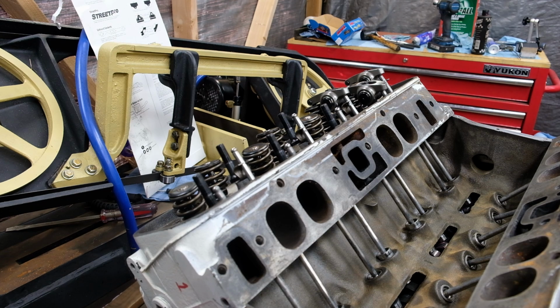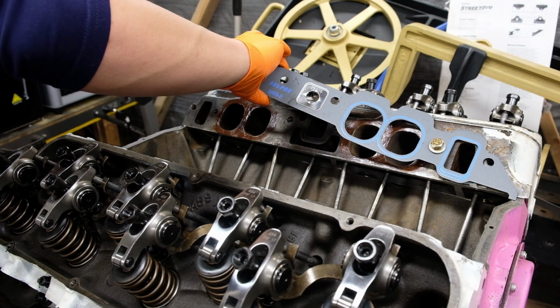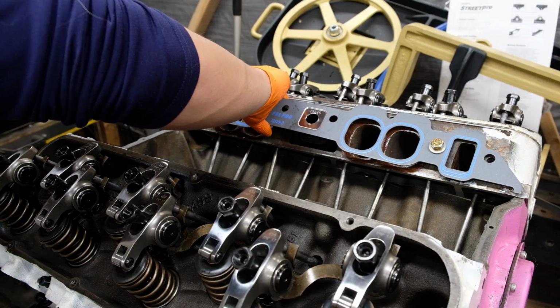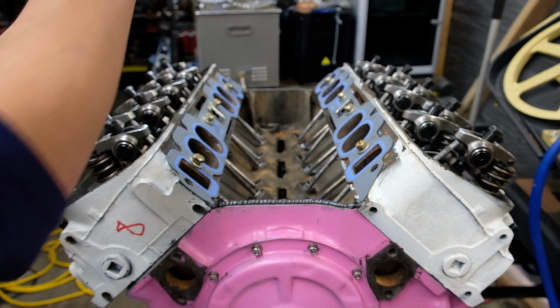The last intake manifold gaskets I used leaked, and I had to seat the manifold pretty hard to get it to stop. So I'm using the upgraded Fel-Pro gaskets with an outline of hard sealant to hold it in place until the manifold goes in.